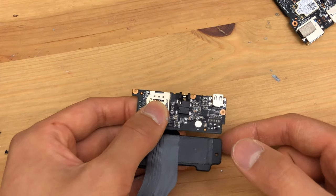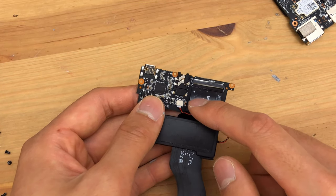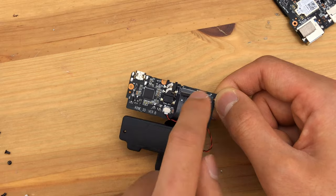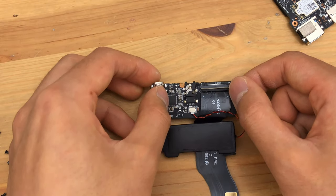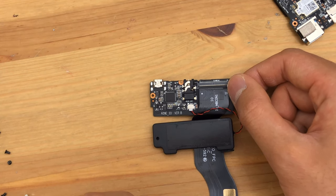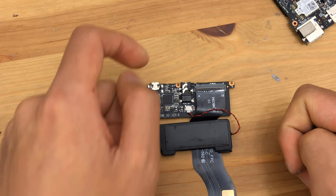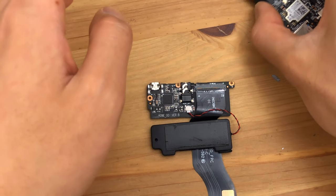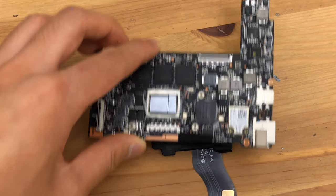There's a SIM card slot, which is unfortunately unused. On the other side we have the flat flex. That chip is a Realtek audio chip — so that's an audio codec — and that's the speaker connected right there. No dedicated amplifier, actually that is the amplifier. The sound is actually quite loud considering the setup. Anyway, that's about it for the quick tour. I'll put up the big picture of this and will label the chips so you can have a closer look at your convenience.